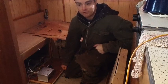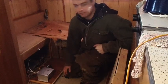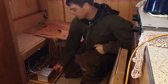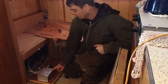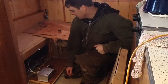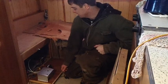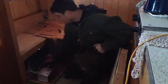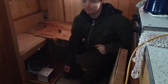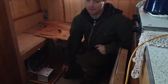When I only had 6 watts of panels on it, that wasn't enough — at least on cloudy days — to bring the battery back up to full charge when it was sucking juice 24 hours a day, even though it was a small load. And even when the power is off, the charge controller does take a little bit of power to run 24 hours a day — kind of like a water leak running full-time. So I noticed when my battery was down to 11.8, it was because I was leaving the inverter on.